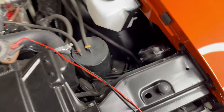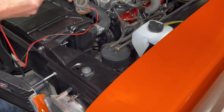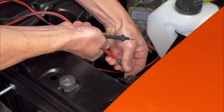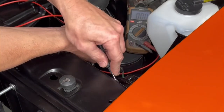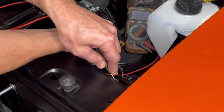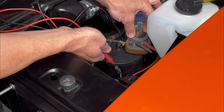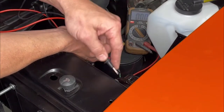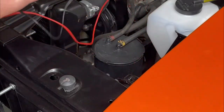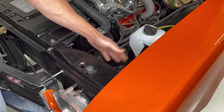Take your hot — you can probably just stick it in here to get it to stick — and then take your ground and put it here. I'm not going to get any power right now because I don't have my buddy. When you get your buddy, hook this up and put these together and see what kind of voltage you get on your meter. It needs to be on DC current, not AC. You should get somewhere around 10 to 12 volts. That's how you measure it if you're trying to find voltage at your horn.